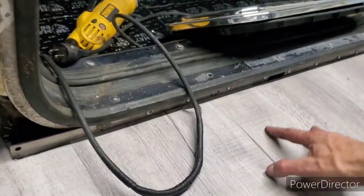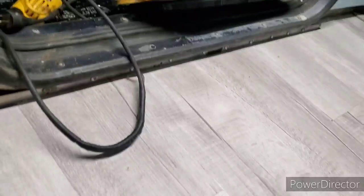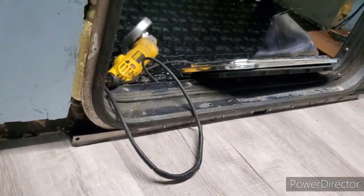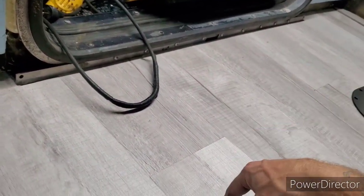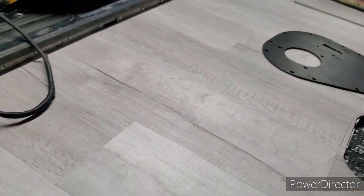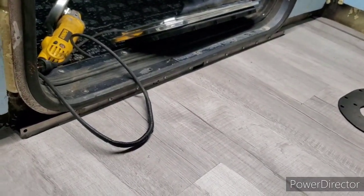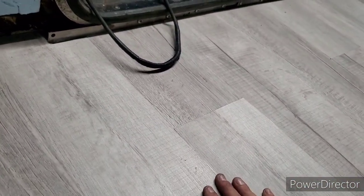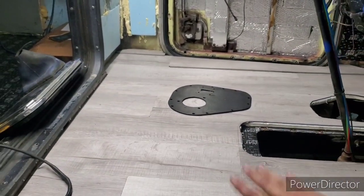And back here, you've got 2 rivets here and 2 more rivets here, and they come in from the bottom, so they're protruding at least about a half inch through the floor. All the rest of them are the correct way, with the rivets going down through the floor. So that's what the styrofoam is for. Once you put it down, it gives you a nice smooth level surface to work on, and you won't have anything that'll impede what you're trying to do when it comes to putting this floor down. And it'll go in nice and smooth. You'll have a nice clean finish all the way across.